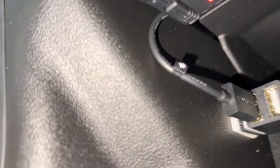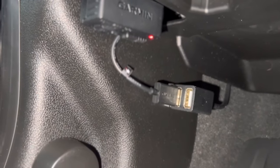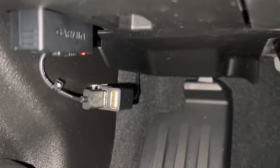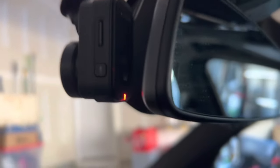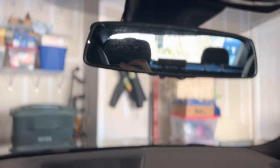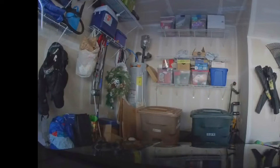That's pretty much the final setup down low — you can see the adhesive velcro attached to the USB ports, mounted to the side of the trim. Now go back up to the A-pillar: all that wire is hidden inside the weather stripping inside the A-pillar, so just push that back in. Use the screw we pulled out earlier to secure it — no wires are showing, they're tucked inside the headliner. You can push it down inside that plastic trim too. The power's on, works fine. Turn the microphone on or off — your choice. There it is, tucked away behind the rearview mirror. You don't even see it. Looks great, and that's really all there is to it. Hope this helps — thanks for watching.